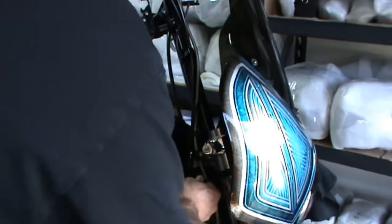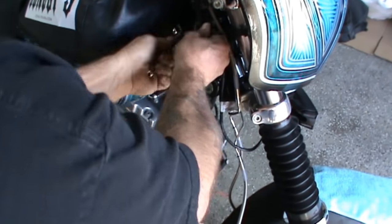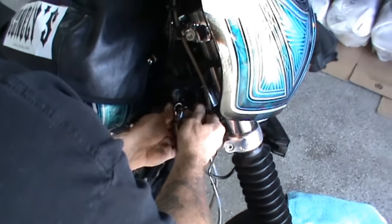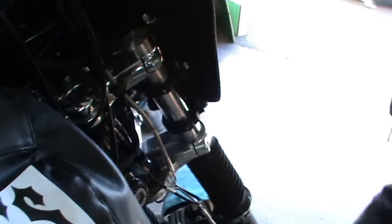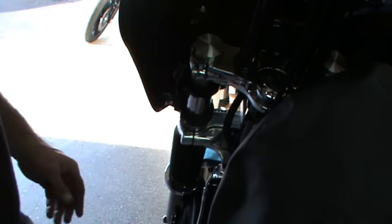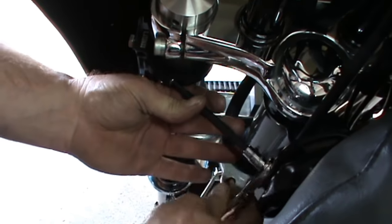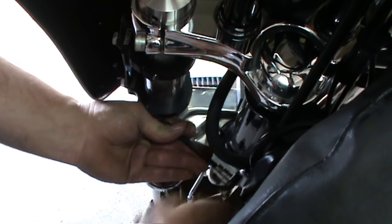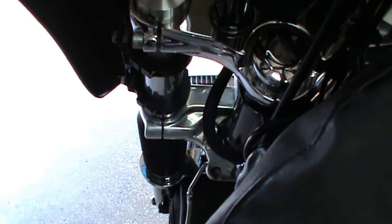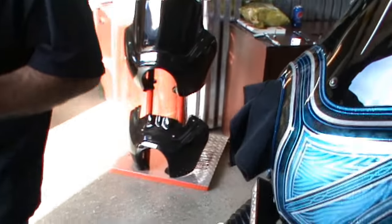I'm going to loosen the two clamps, from the outside only. Turn the handlebars back in the same direction again. You don't have to use this long of a ball-end ratchet — it's fine. These are the two you want to loosen: the top one and the bottom one. You only need to loosen them a little bit. From there, you want to push the two clamps down at the same time. If you have to, you can reach across and loosen them.